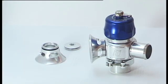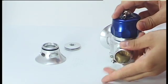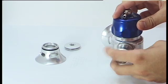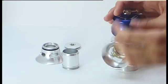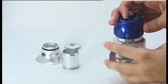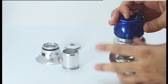Brand new TurboSmart dual port is a staged blow-off valve that can be customized for a variety of different configurations. In the standard dual port configuration, the ports are staged so that the bypass valve comes on first and the atmospheric trumpet comes on second.